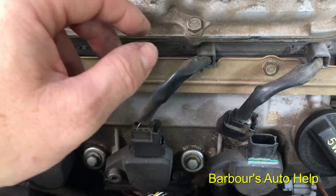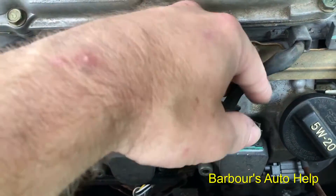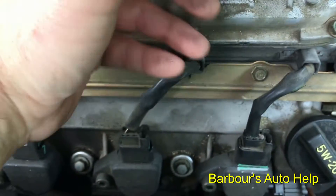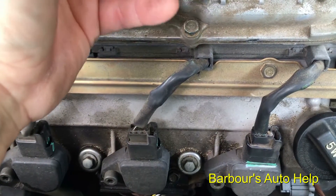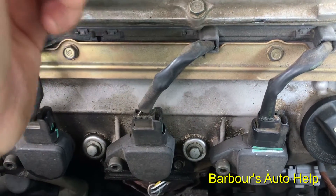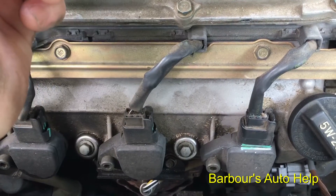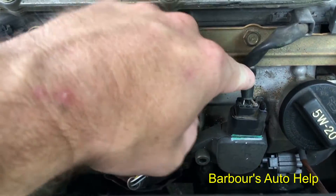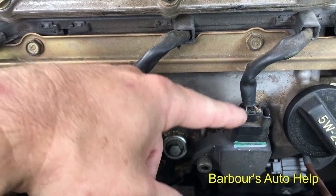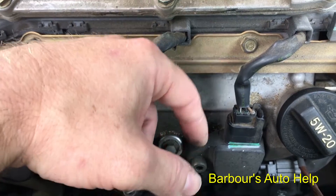How do I know this? Well, it happened to me. I was trying to figure out a misfire on a four-cylinder and I disconnected the ignition coil. There wasn't an RPM drop, so we suspected it was the ignition coil and replaced it — but the misfire was still there on that same cylinder. Turns out I had blown the computer when I disconnected it. I also found out after the fact, in one of my training classes, that you're not supposed to do that for that very reason.